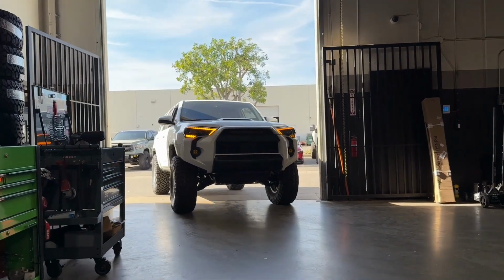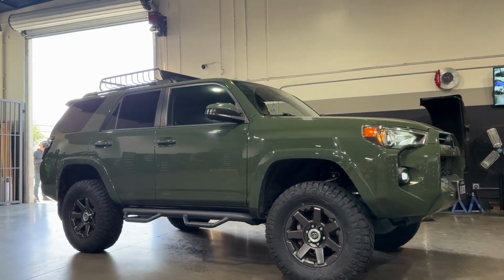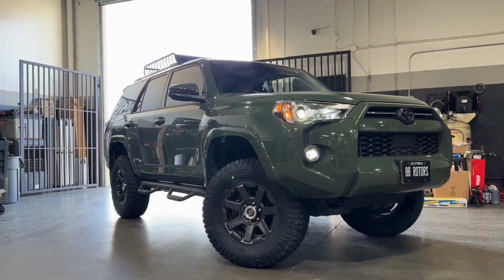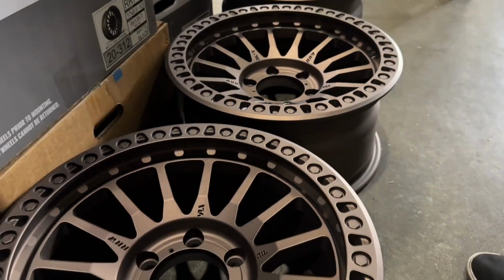Like your factory wheels or just don't want to change them out just yet? No problem. You can actually fit 285/70R17 tires on them like you see here. All you need is a proper lift with a proper alignment and fine-tuning of the caster to make sure everything is dialed in properly. We offer that service here.